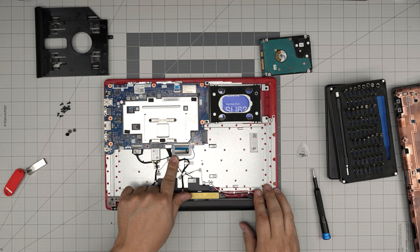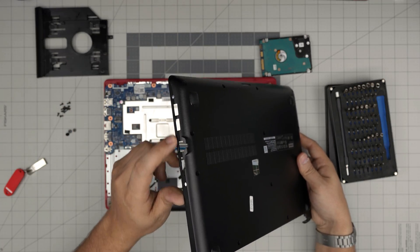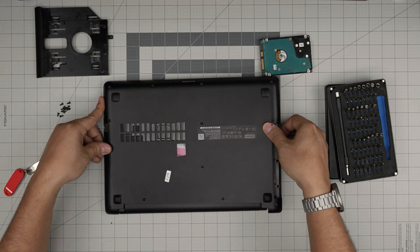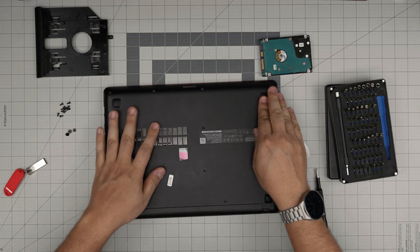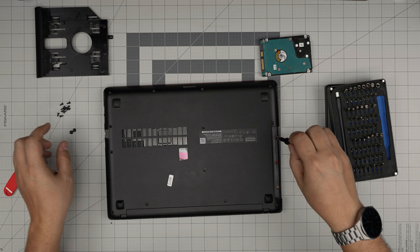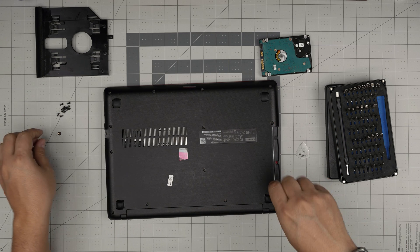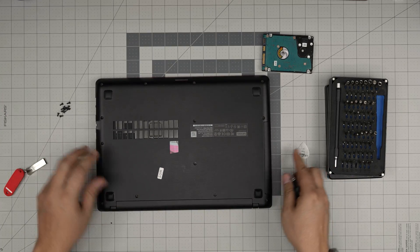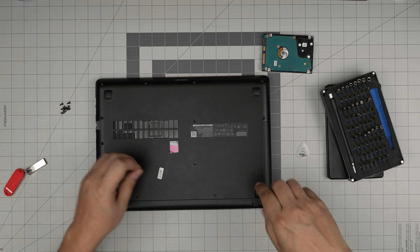Once you're done, if you disconnected the battery, plug it back in. Grab the bottom cover — make sure you put the HDMI and USB port section in at a 45-degree angle inside the jack and scoop it right in. Hold it and push down the other corner; make sure you hear those nice click sounds all around. Put the flat screws right under the DVD drive — I'll put two since one is broken. Slide the DVD drive caddy plastic back and start putting in the rest of the screws.